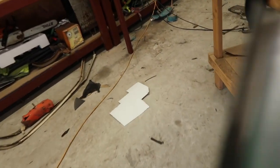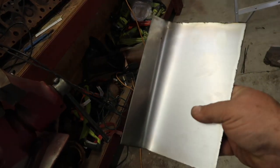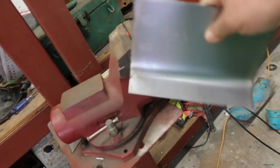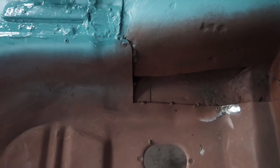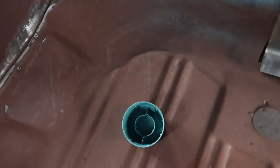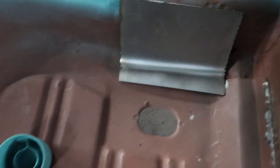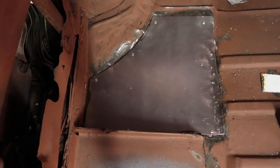What I was doing with that cut we just made was this little — I think it's an 8 inch by 6 inch piece. I put it in the vice and just pulled down on it a little bit, and we're trying to make this piece that I had to cut out right here. It's just going to go just like that. So I've got this patch made and it's pop riveted in place, just ready to weld. And then I've got these two right here that I'm mocking up for these little pinholes.